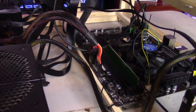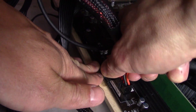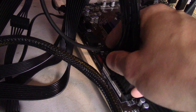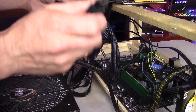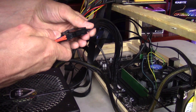At this point, your secondary power supply will get the signal from the motherboard that it's supposed to come on. To install this, all you're going to do is unplug your power supply from the motherboard, replace it with the main splitter end — the female end of the splitter — and plug that into the motherboard. Then go ahead and plug the two 24-pin plugs coming off of your power supplies into the splitter.